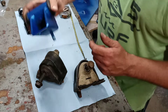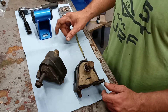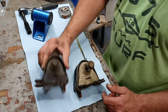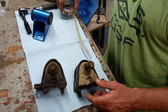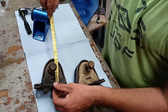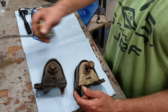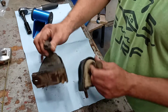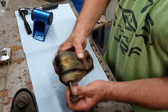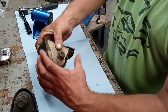They've got really good heavy welds on them. I actually made a mistake — the first ones I ordered had a one-inch lift, which wasn't right. For anyone who wants to know: from the bottom of the bracket to the center of the bolt hole is two and a quarter inches — that's your standard stock engine mount height.